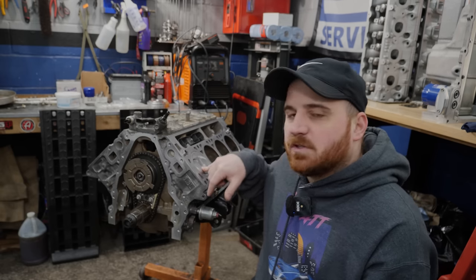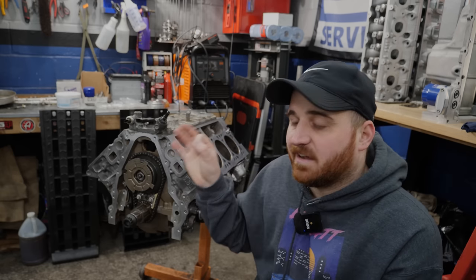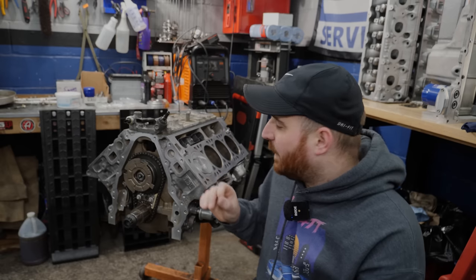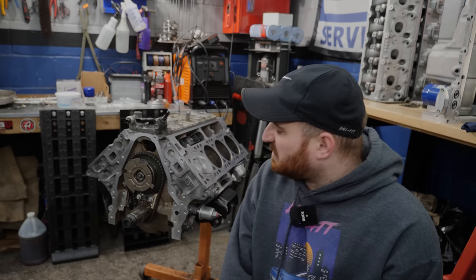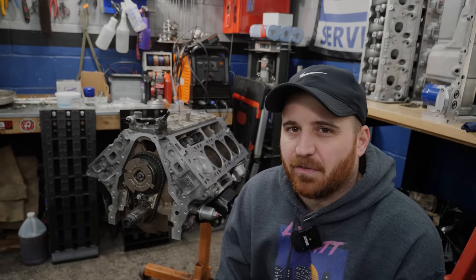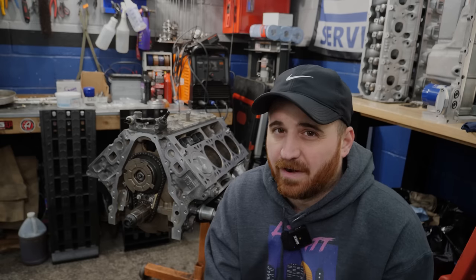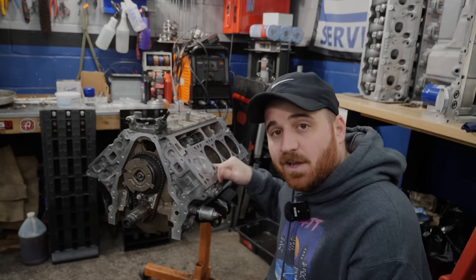What happened was when I was making the cut that I set to 35 thou, the collar, because it wasn't tight enough, kind of slipped down. So I ended up taking off probably about 100 thou. This isn't really a huge issue. The pistons have plenty of material there, so it's not like I was actually going to go through the piston or anything. After the first cut on this piston, I didn't want that to happen on the second one and slip.